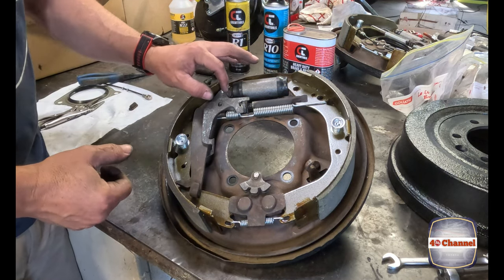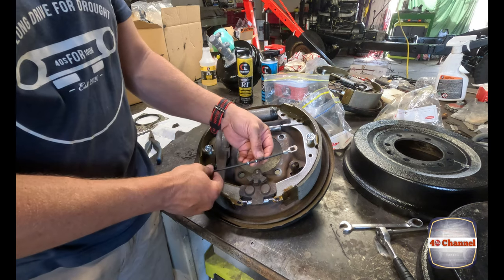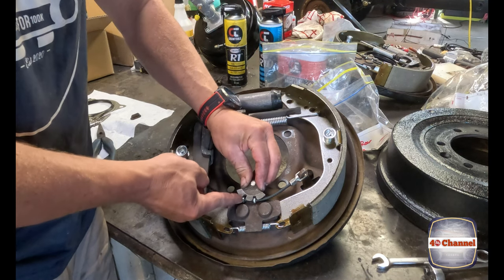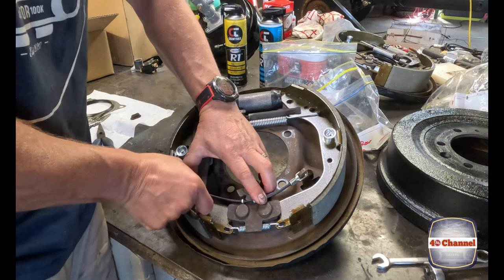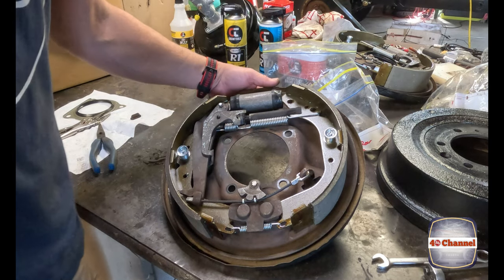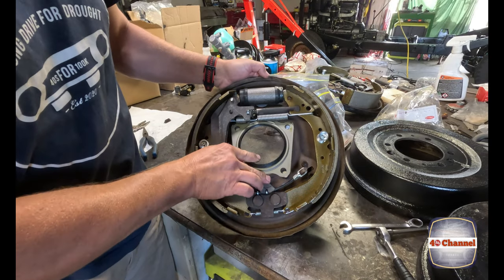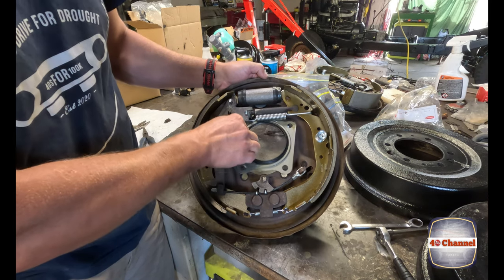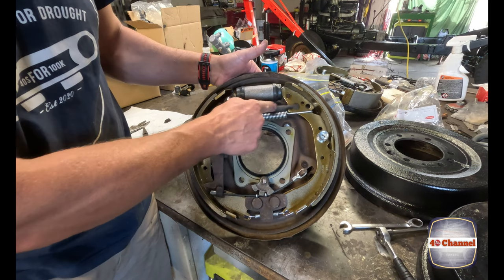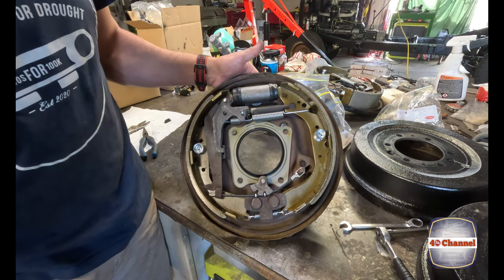Now we need a little circlip on the top of that - we've got a little circlip or snap ring that just goes up in here. Now our tensioning cable goes right over our hook - line up our two little notches, pull that in. That's done. Our seal will go on there when we go to bolt into the car. Brakes are all built - we've got all new springs, all our componentry works, new wheel cylinder, new brakes, new cable. It is ready to go back on the car.